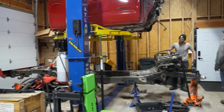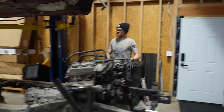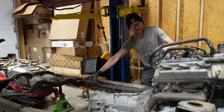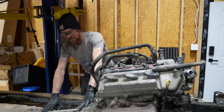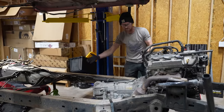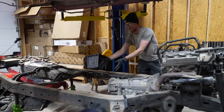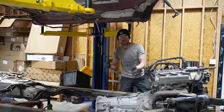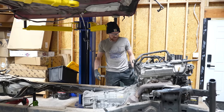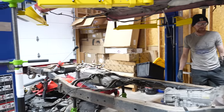In case you were unaware, this is what most trucks look like underneath the body — your two frame rails here. The frame supports your transmission. The transfer case used to be here along with the engine. The engine drives the transmission, which converts engine power into different speeds. The transfer case is that piece Brandon and I took out a couple episodes ago — it switches from four-wheel drive to two-wheel drive and has a gear reduction for more power at low speeds. We're about ready to get this motor out of here.